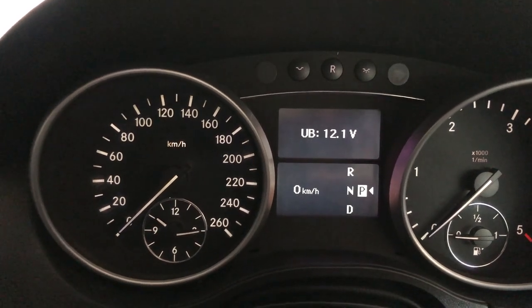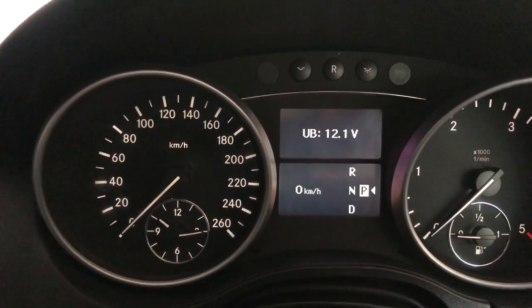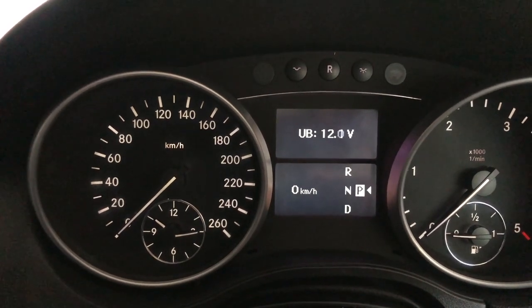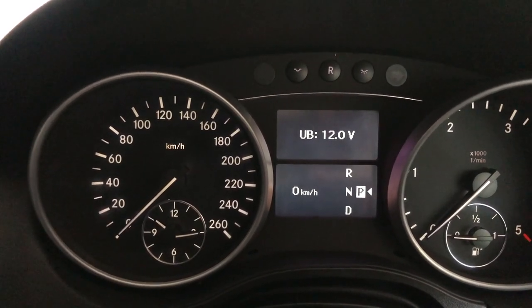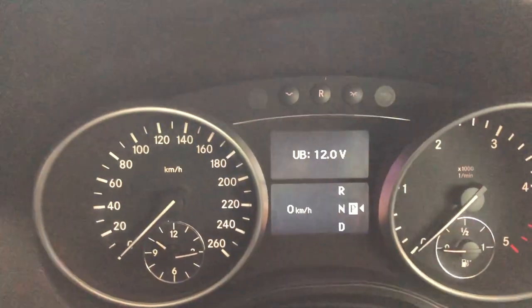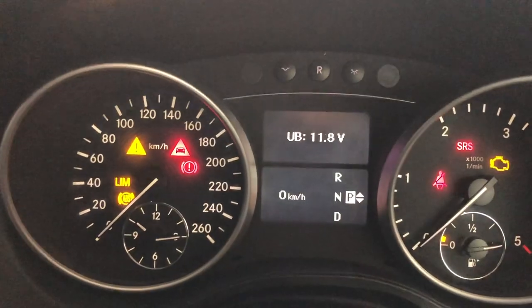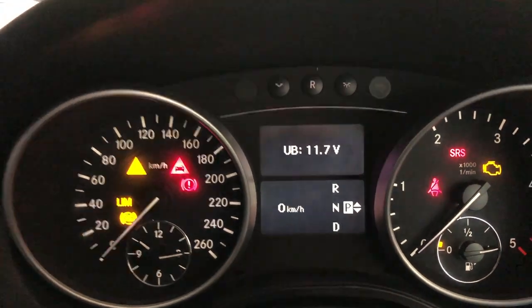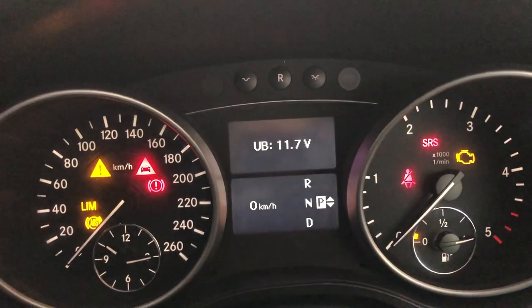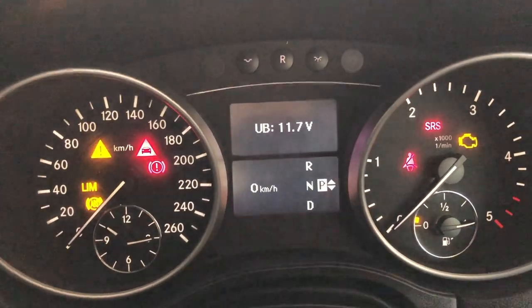Back to testing our battery and alternator. As you can see, my battery is around 12 volts — a fraction over — so it all looks good. If I turn the key one click further to the on position, you will see the glow plug lights come on and they quickly pop off again.